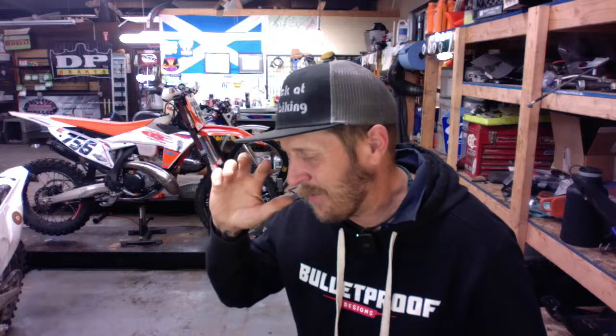So I don't know if anybody's selling a stator that just goes in there. And again, I don't know if the flywheel will be enough magnetism. So there's a lot to ask about that situation and a lot of testing that I'd like to see someone else do. I don't want to get stuck. I mean, it could happen with anything, right? But stators are one of those things I like to have someone electrical do a bunch of testing before I try it out, because it's the thing that will leave you dead stuck on a motorcycle if it fails.